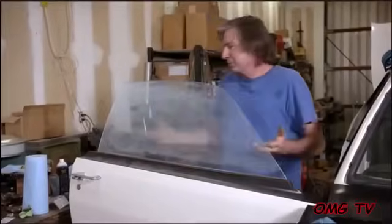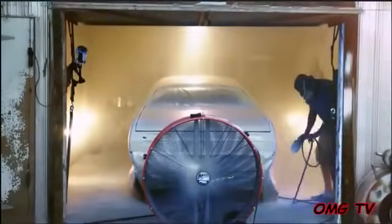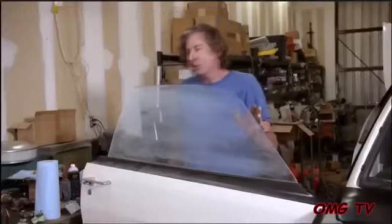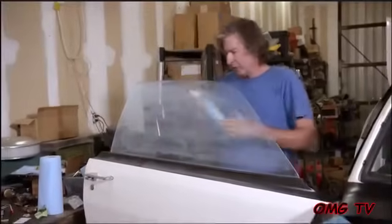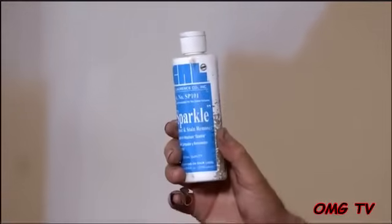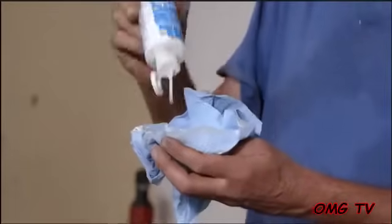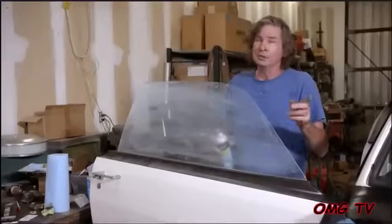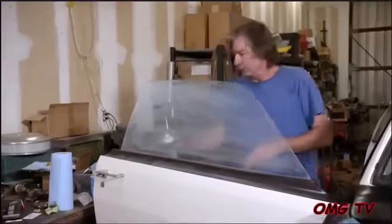Freiburger is making a big deal about overspray all over the glass, but whenever you're doing an extensive paint job like this, you're going to get debris on the glass unless you take it out — and we left it in. First step at cleaning it: just use regular spray-on glass cleaner. Then you can use some Sparkle — it's an industrial product you can get at your glass supply and it takes some light overspray off. If you've got some really heavy deposits, you're going to have to razor blade it, but you can scratch your glass so be careful. I'm going to avoid it at all costs.